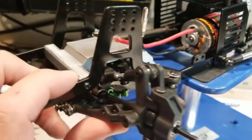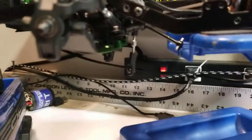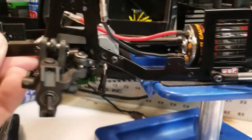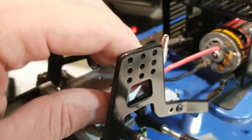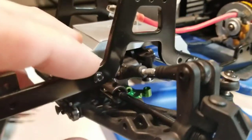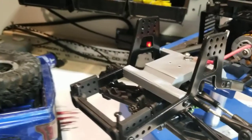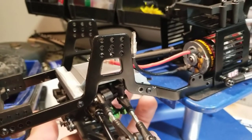Everything fits, everything's centered well. The bottom of the front diff sits about three to five millimeters lower than the skid, so I technically still need to raise it up a few millimeters — I'd be happy with a millimeter or two off. But raising it much more, the steering linkage is going to be really close, unless I slide the differential back forward. If I slide it back forward too much, the top links here are going to start rubbing into the chassis.